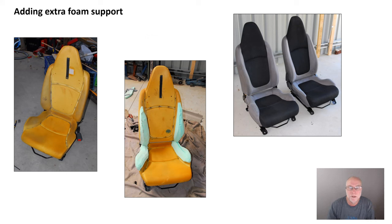The first way of modifying the shape of the car's seat is simply to add foam in different locations. Over here we have the standard seat with the trim taken off. Most seats, the trim unzips or unclips quite easily. Foam has been added down the rear of the seat on the sides and at the base of the seat to give more side support. When the cloth is stretched back over it, it smooths out the foam, so you don't even have to shape it that accurately.